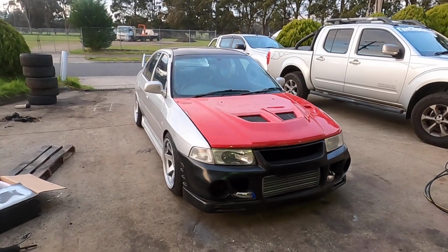I wind a little bit of fuel pressure into the fuel pressure regulator just to push a little more fuel through the engine so that we're not getting unsafe with the air fuel ratios while we drive it, because obviously it's not tuned yet. So anyone that's worrying in the comments, I did that for you. So you're welcome. Alrighty, it's drive time.